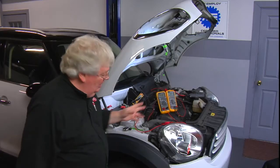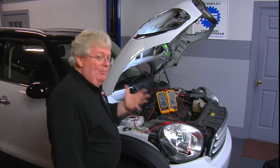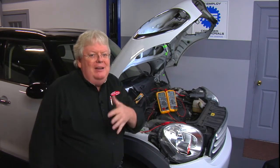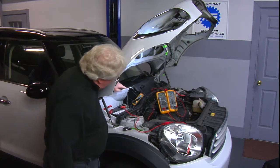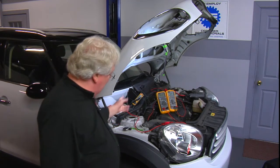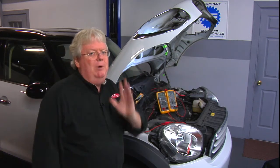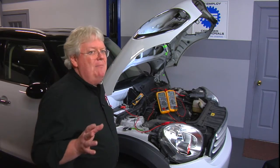In this case I have very little current flow — 12 milliamps. What is my resistance reading here? The real McCoy resistance of what a good ground strap should read — less than an ohm. It's 0.16, so sixteen hundredths of an ohm. That's pretty good. Now, if I didn't want to do all this work and just wanted to see do I need to go snooping with parasitic current draw testing methods like this — obviously if I don't have one of these high-dollar amp clamps, I'm kind of stuck having to take the cable off and try to keep power alive. Bunch of work if the problem's not present.